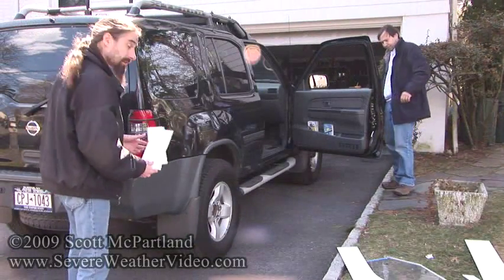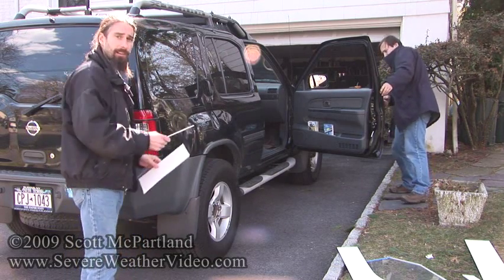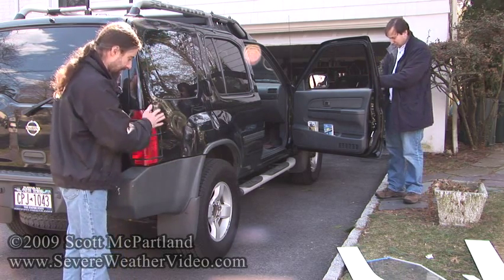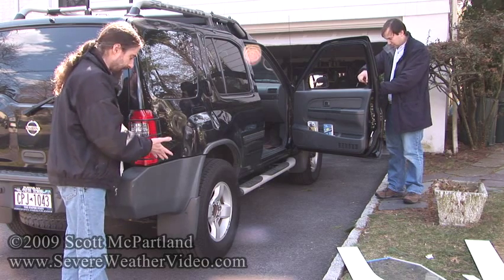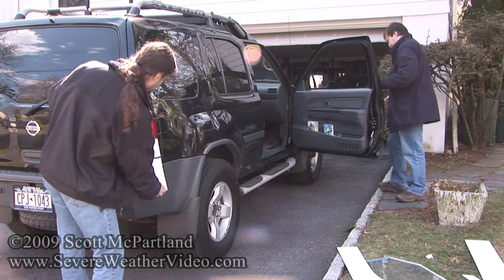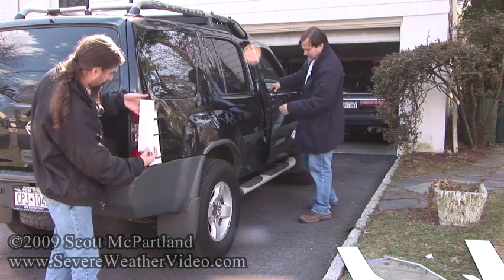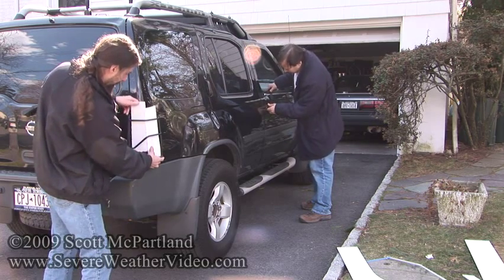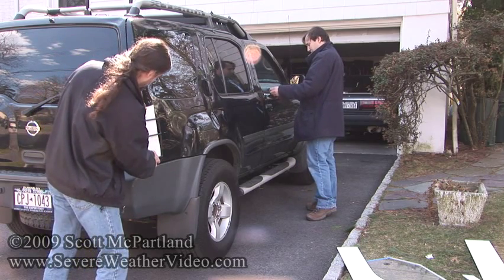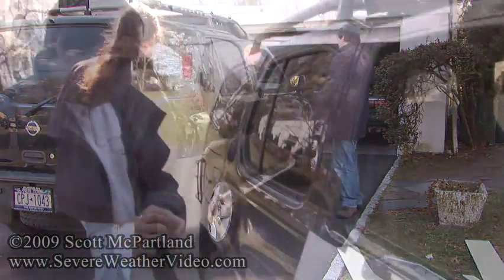Yeah. So here are the templates that I have cut out for the rear tail lights that we're going to have fabricated. The Lexan. We have not had these covered, just this kind of stock guard that came with the truck, but we're going to actually cut out some Lexan, and we'll have one piece that'll get cable ties for here and here, and a secondary piece which will go in through the top or bottom or whatever, and same premise. They'll be cable tied, obviously it'll be see-through, and that will protect the rear glass from the huge hail. Let me know when you're ready.